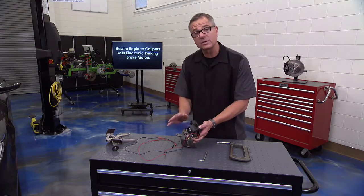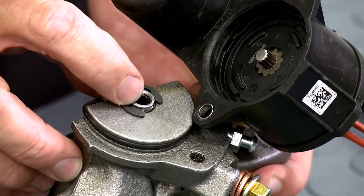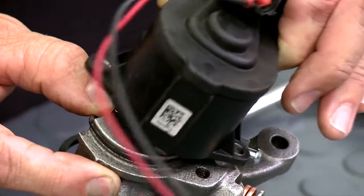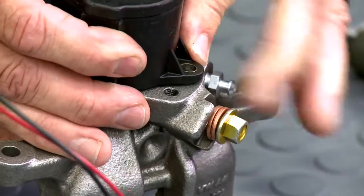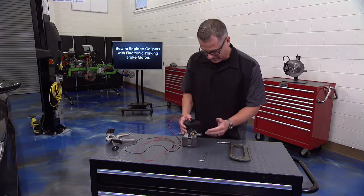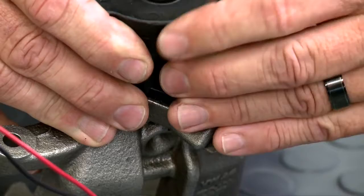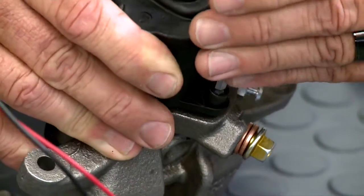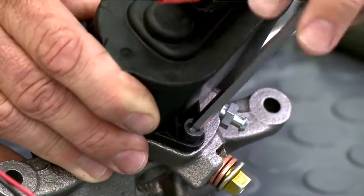To reassemble, hold down the O-ring and insert the motor. It may not spline up right away — it might be in an off position. Don't torque down on that bolt and break off an ear. Place it down, feel for alignment, and if the bolt hole isn't lined up just clock it slightly to find the bolt hole. Once you're in the splines, it's okay to move the motor left or right to align. Reinstall the bolt, torque it to spec — be careful not to overtighten since you're dealing with plastic and sometimes aluminum.